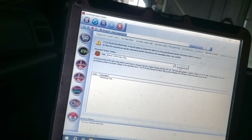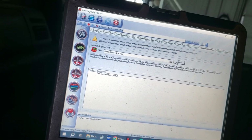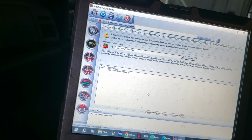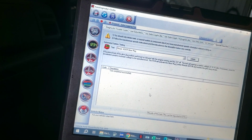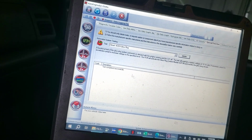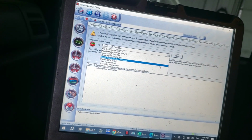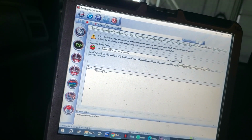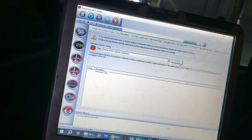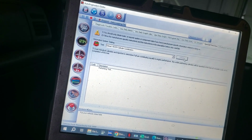So it says you've got to keep it up, right? Okay, so it passed it, so that's good. That means it's not seeing that one of them is disconnected. So that's usually going to tell me that little plug is okay. It'd be nice if we were able to do our contribution with the cold oil. Let's see if it's going to range here. Well, it is performing the test. So let's see if it's going to call an injector or not.